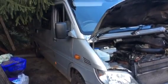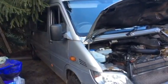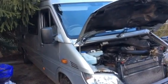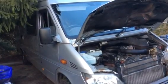I've been chucking out water, pressuring up in the radiator big time. Not the classic signs, no water in the oil, no oil in the water, but it's got to be cylinder head gasket, or failing that, it's got to be cylinder head. Either way, it's not such an expensive job, just a very time consuming job, so labour charges would be a lot.